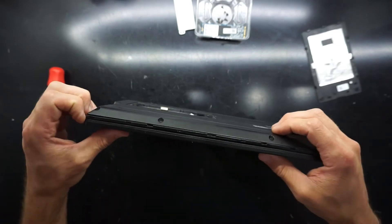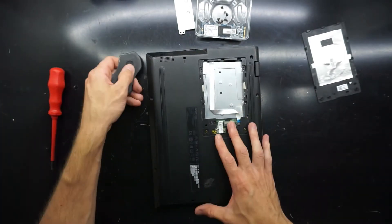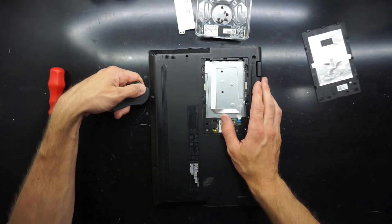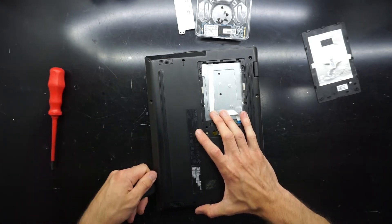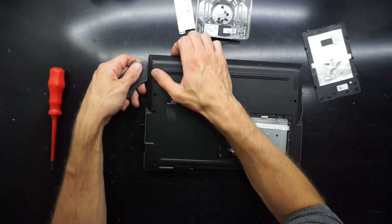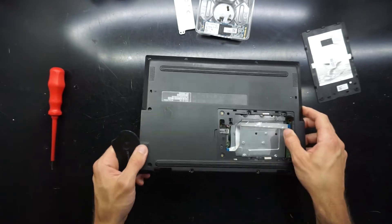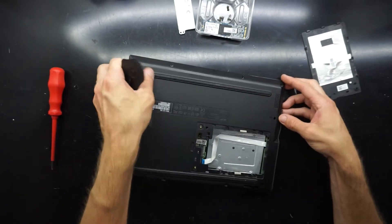From here I'm just trying to spot the seam of it, and I'll use a small plastic pry tool to get in there. You could try this with a flat-headed screwdriver, but you will be damaging the plastic as you try to get around it. If you've got something small like an old bank card, that may also do the job just fine without damaging the plastic.